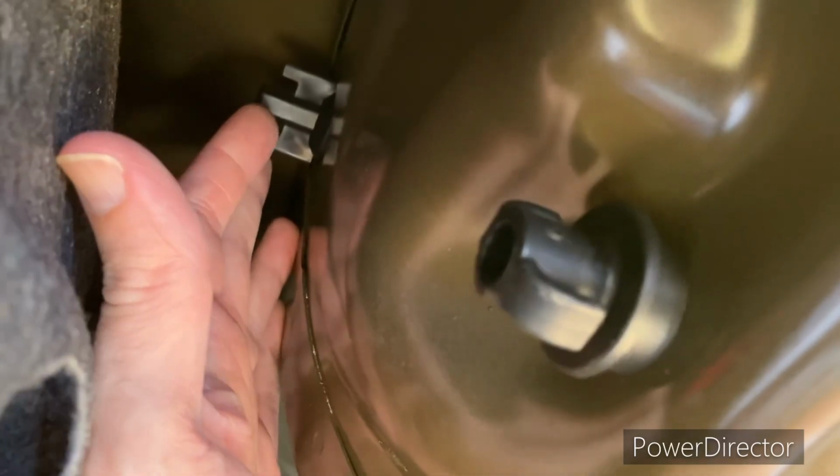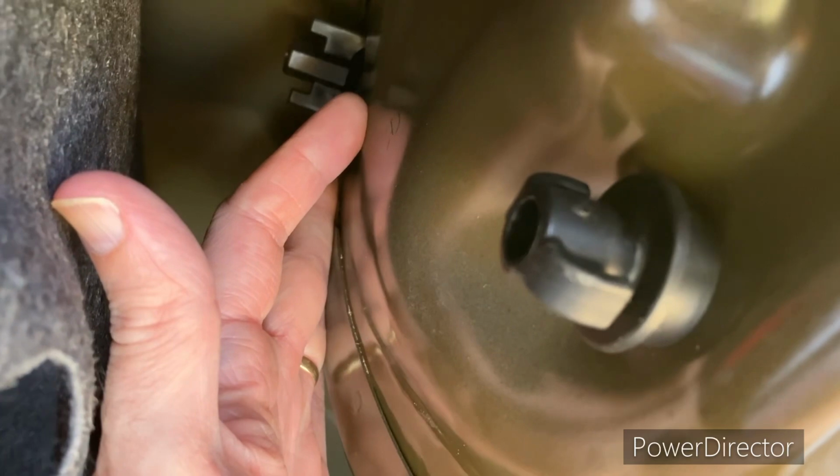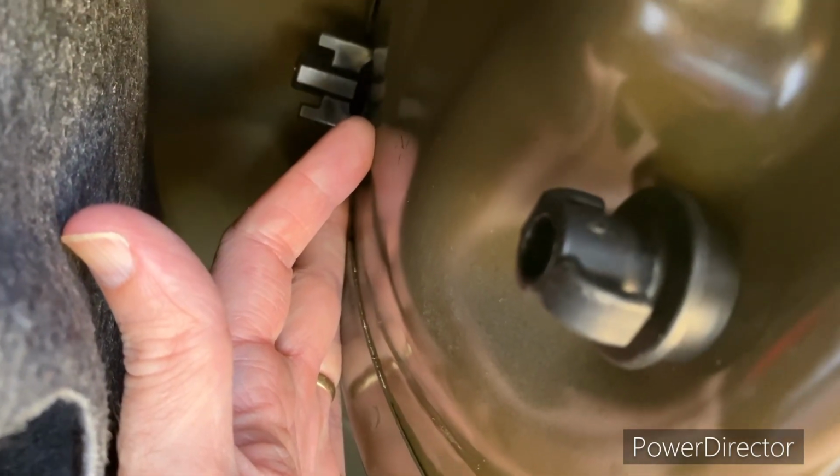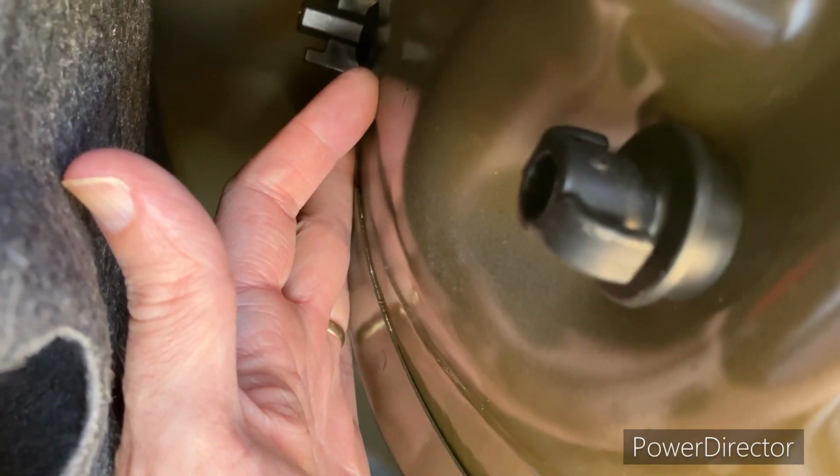That way I'm exposing both of these nuts here. And that appears like, oh, there's not one under the bottom. So it's take these two loose, and the taillight assembly is gonna come off. Now, it will still have wires from the wiring harnesses screwed into it. So it's not just gonna fall off the car, it's still gonna have stuff connected to it. Just loosen these things up like this. They've never been taken loose. This is a 2010, first time I've ever done anything to the taillights.